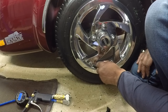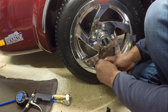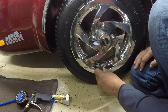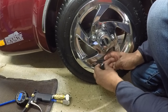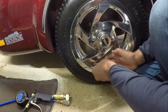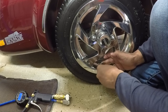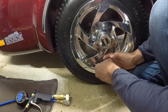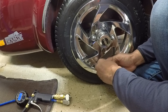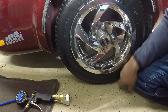When you screw it onto the valve stem, the pressure is actually activating the sensor. Now that it's tight, I can take my tube and tighten the locking nut up to the bottom of the tire sensor. You want to make sure that's nice and tight because you don't want to lose that sensor — that sensor is fifty dollars a piece.